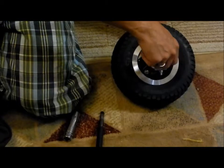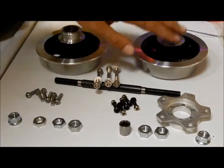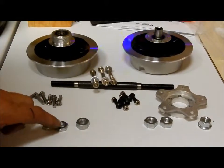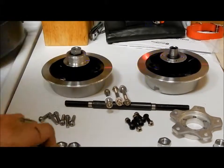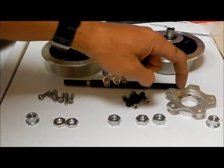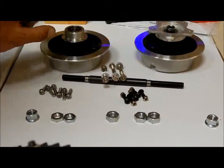Let's talk about these aluminum wheels. Over here we have the aluminum wheel kit laid out. The two halves of your wheel are held together with three bolts. The longer side of the shaft comes out on your sprocket side and that's also where this little spacer goes. It comes with five different nuts — usually one of the two shortest nuts on the outside of the brake drum and a bigger one behind it. It comes with five bolts for shimming, five bolts for holding the chain drive sprocket to the star hub, and six bolts for mounting the star hub to the wheel, plus two new axle nuts. It does not come with a valve stem extender or chain adjusters.